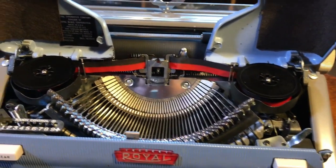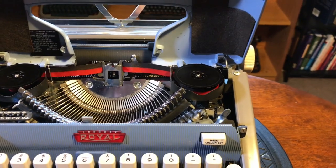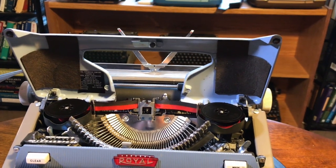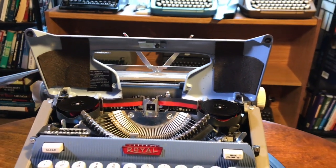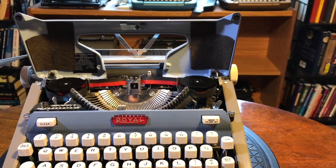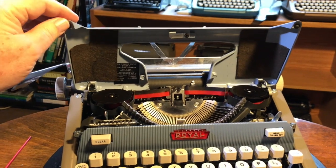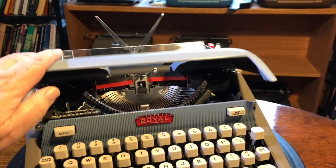Look down inside of it. This did not come with the twin packs, but it did come with some nice metal spools, so whenever it had been changed, at least we got the metal spools. And some of these, especially the lower models, like the 400 and the 600, had sort of a foam cushioning to deaden the sound, and those rotted away pretty quickly. In fact, when I had to clean the one that had that, I just took a paintbrush and brushed it out, and it just came off as dust. So in one of them I had to replace the sound deadening material. But in many of the 800s it came with a felt, and that lasted a very long time, and a corrugated front piece for design effect. So very, very nice in that sense.